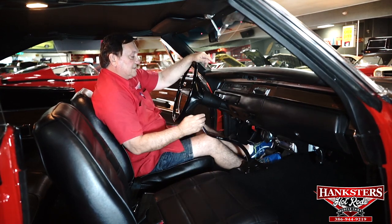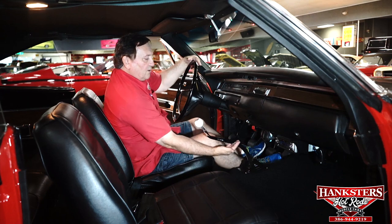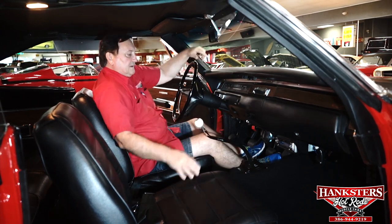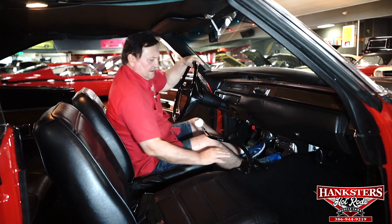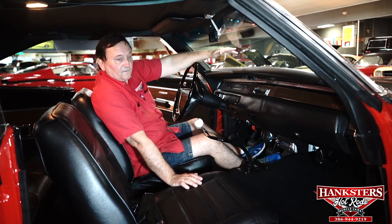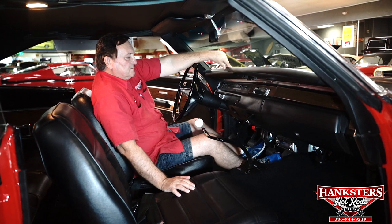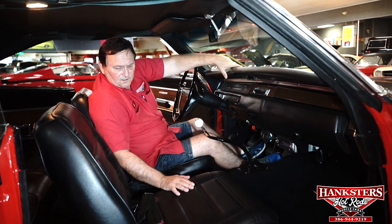Key to the whole operation. Look at this. 1, 2, 3, 4. 4-speed. This arm did not come as a standard shifter arm in 1969. It would have had one that came up and back about this far, and it would have been round. Hurst released those. This is a very hard arm to get. This is out of a '63, '64 Max Wedge car, or a 4-speed Plymouth Fury. That's what these vehicles were fitted with, this big flat curved S-shaped Hurst arm. Fantastic car.